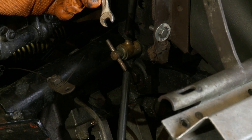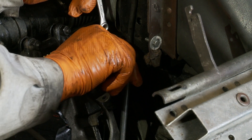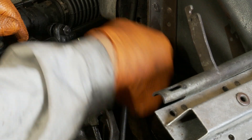The trick here is to use a small spanner - this is a six mil spanner. Just with that on, it makes it easy to undo the tap. You can try pliers, but it's very easy to bend these tangs.